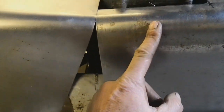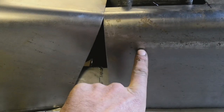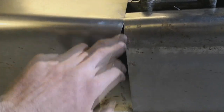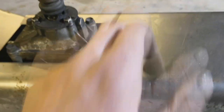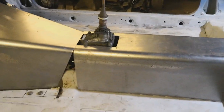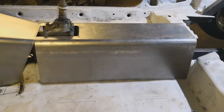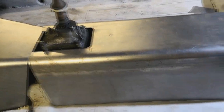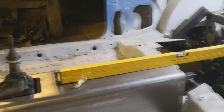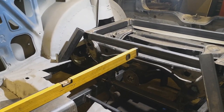Down here there's actually going to be a bit more welded in to continue this flange down. This is the problem when you don't have a full plan from start to finish and just make it up as you go - I could have just had this lip on the panel, but unfortunately I didn't really know how I was going to do the tunnel. I've got a bit of a gap but that's easily fixed. What I was thinking of doing was cutting this panel at the same angle to match so it pulls up tight, then weld it. The removable section of tunnel will come to about here and the rest will be fixed.